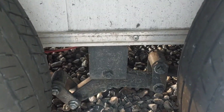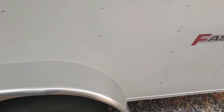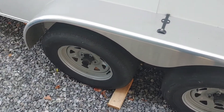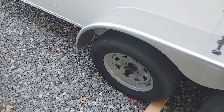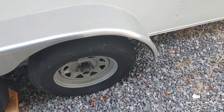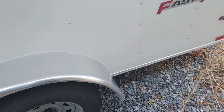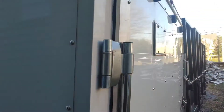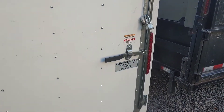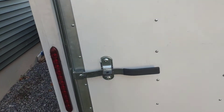Check your carriers and make sure they're all intact, not dented or broken. Get underneath and check the overall stability of your frame — make sure it's not twisted or dented. Check all your wiring while you're under there: make sure all wires are connected, nothing's dragging, disconnected, eaten away, or dry rotted. Check all the bolts on the trailer, make sure everything's nice and tight, and make sure your plate is secure. These things take a beating on the road.